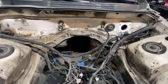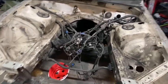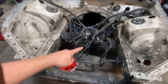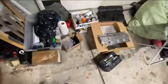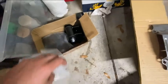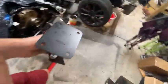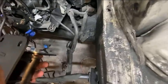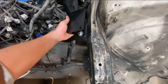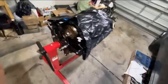After that modification it should fit better. I'm going to be fabricating some mounts myself for both the transmission and the engine. I've got a couple of steel plates ready to weld up. Another thing that's going to be useful are these generic LS swap engine mounts — basically they're going to go where the stock engine mounts were, with one on each side to hold the LS engine.